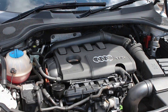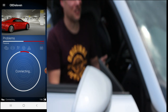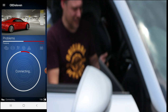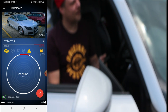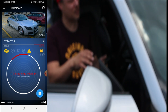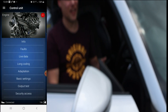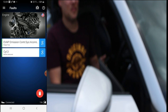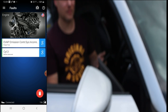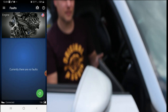So we've plugged in now. These things always take ages to connect for the first time. Rob has OBD11 as well but not the pro version, so we'll see if the pro picks up anything extra. Right, so we've got three control units with faults. We've got something for the engine - never good. We've got an Evap system incorrect purge code. What we're going to do is delete all of these just to see if they're previous codes. Have you ever deleted any of these, Rob? No, I've just left them. So these could be from a previous owner.